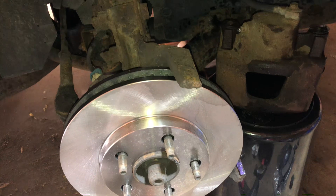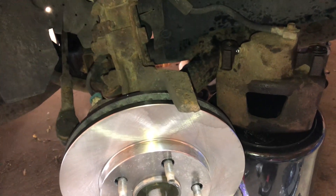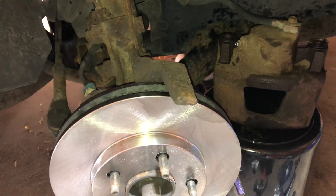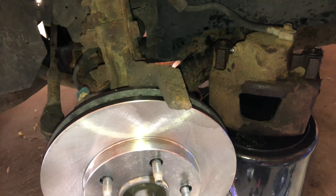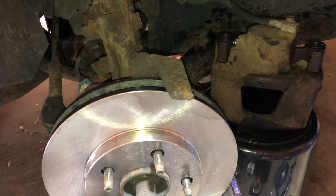No wonder — like my brakes, I honestly was probably only using one brake. I had a spongy brake pedal and I actually thought, oh maybe I need to bleed the brakes. I'm starting to think maybe it was just because this was a seized guide pin, and the brakes on that side weren't even working.